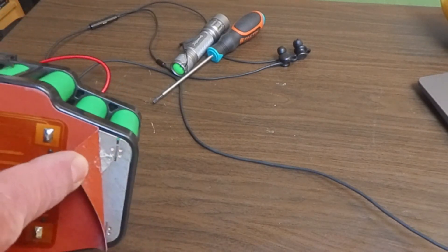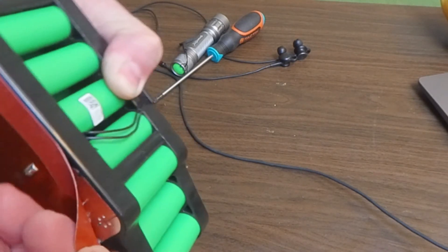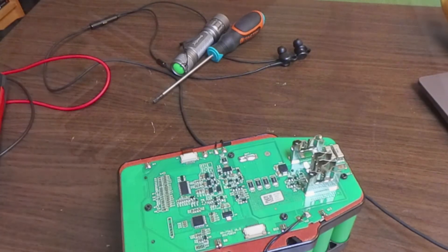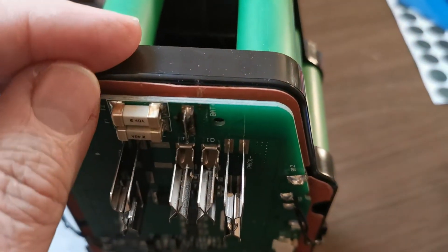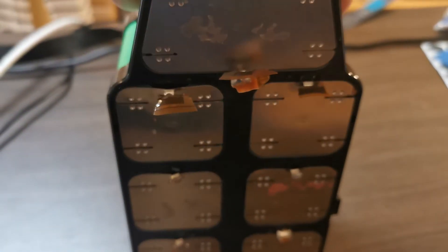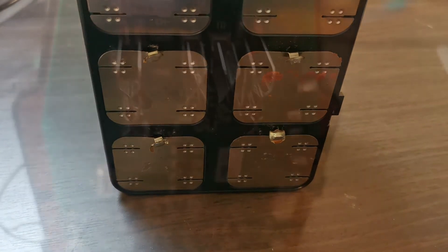You loosen this cardboard and move the soldered connection there — it goes to the front, also to the battery management part of the system. When you've done that, you bring out the big soldering iron, because these connectors are kind of hard to unsolder. They carry a lot of heat, so I use a 100-watt soldering pen to remove these solder joints.